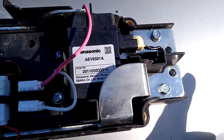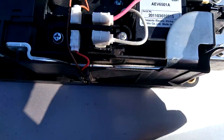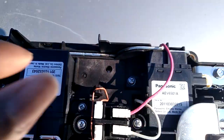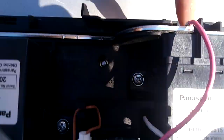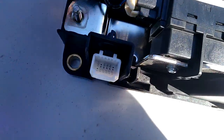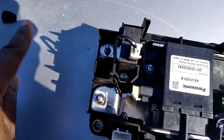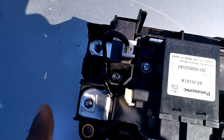This side comes from the front of the car, entering into the battery — both sides, positive and negative. This one goes through the pre-charge resistor and straight to this current sensor. The current sensor senses what goes into the battery and what comes out of the battery.